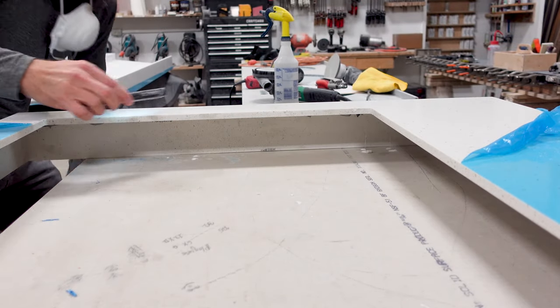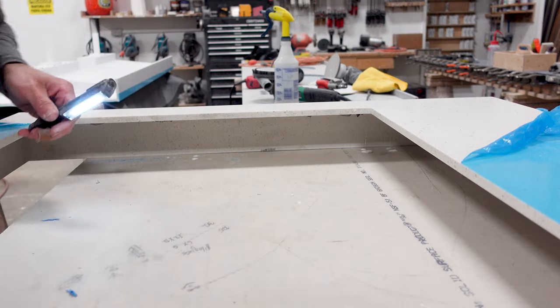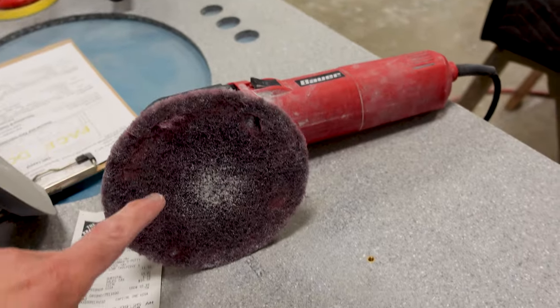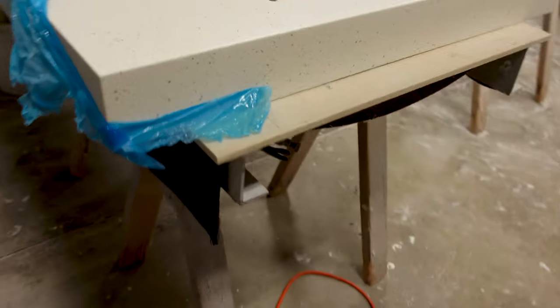The light helps see whether it's blended or not — this looks perfect. As I look on an angle it really blends in nice, there's no harsh line at all where the material is blended. That's due to this maroon Scotch-Brite — very important that you use this. A brand new one will do the job even nicer. Anyway, that's all there is to it. If you have any questions comment below, thanks for watching, and I hope this helps — take care.